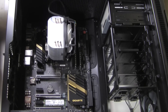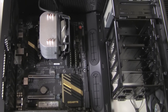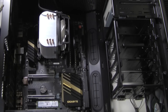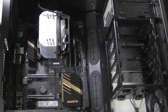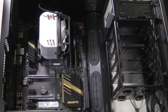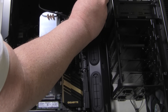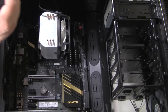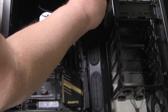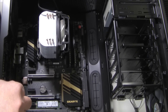Now it's time to put the motherboard into the case. I had the standoffs in — it came with eight, which is exactly how many I needed. This is where it's really important to have a magnetic screwdriver. You can't put this board in without one — there's no way you can get your fingers on those tiny screws. If you're going to build a PC, make sure you have a magnetic number one and number two screwdriver. You don't want to over-tighten these, but they need to be tight enough, and you have to make sure it lines up properly with the I/O shield.